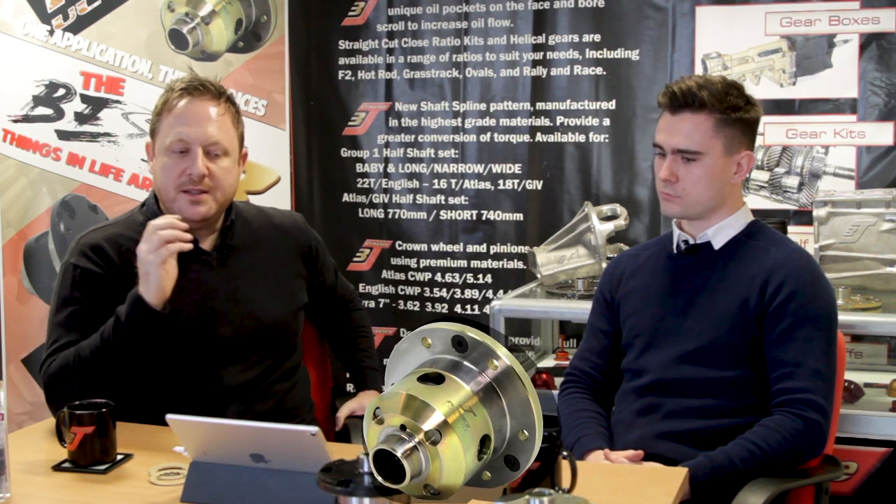This is our core differential. NXG Ultimate — this is our top end diff. We've put in the sintered plates, which give absolutely no noise. We've upgraded materials on some of the internals to make them as strong as possible. It's geared up for people who are right at the top — no stone unturned, belt and braces, absolutely full-on motorsport differential.